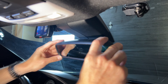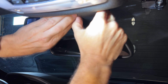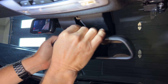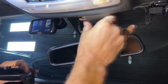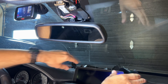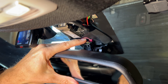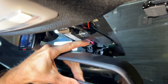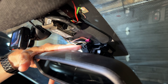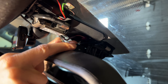First, we're going to tilt down our mirror. On a BMW this actually seems pretty sturdy, but you've got to pry it apart — just like that. There are little clips that hold it together in the middle, and then you should be able to get this shroud out of the way. Now we have two harnesses back here. The one I've already identified for my 12 volts is that little pink or purple colored one back there. To get it out I probably have to move the other one a little bit, so I can just pull it up and out of the way without disconnecting it.